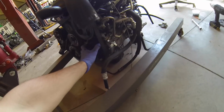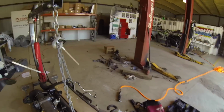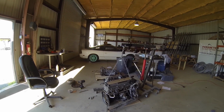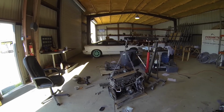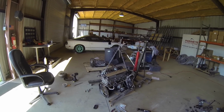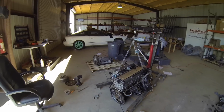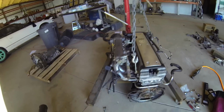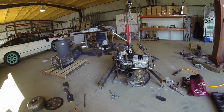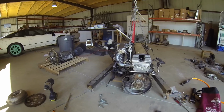Next I'm going to take off the AC compressor. Also, I'm not sure if I showed a picture of the oil pan, but it seems like every single time I order an engine, the oil pan comes smashed in. So next video, we'll probably be taking off the AC compressor and the oil pan, beating out the dents, and then resealing the oil pan back onto the engine. So I guess that'll be a little tutorial video, if you guys are not sure how to do that. Because you definitely do not want to put an engine with a beat-in oil pan into your car, because more than likely it's not going to pick up any oil, and you guys know what that means.